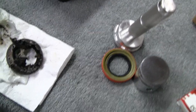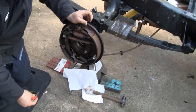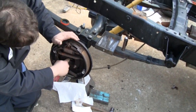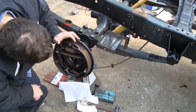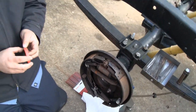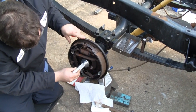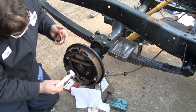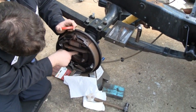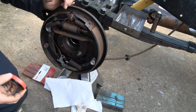All right, we're out there to look at it and see if it's gonna be much trouble putting this one in. Mike has it all cleaned up — a couple little tiny burrs but not much. After 60 years you don't know who's worked on these. We're not gonna put any kind of sealant — actually, you can feel there's a sealant on there already, like a retaining compound. This slides in the inner bore so we'll be able to send the seal all the way to the back. The depth of the counter bore is about twice the width of the seal, so I have an idea of how far back I need to drive it.